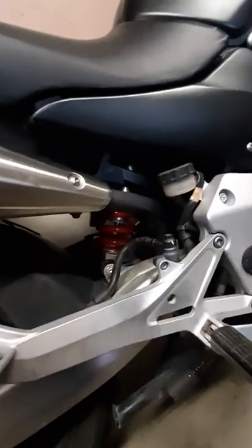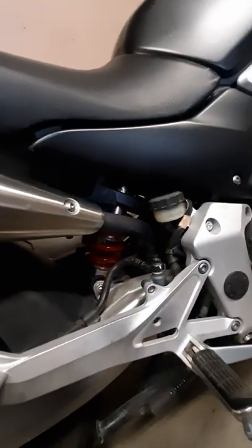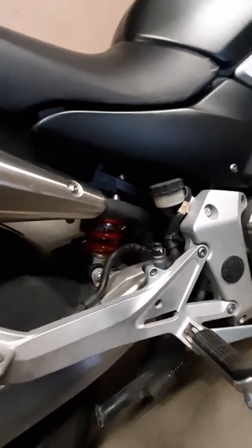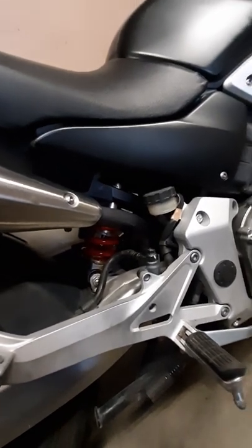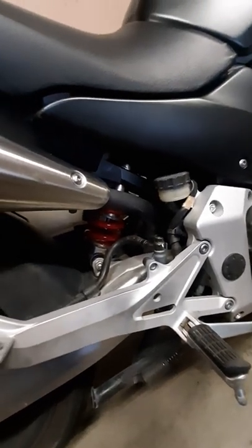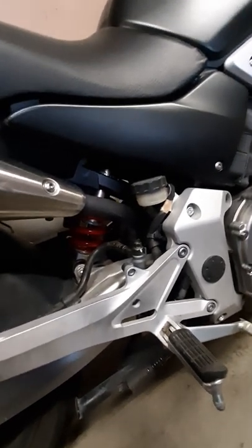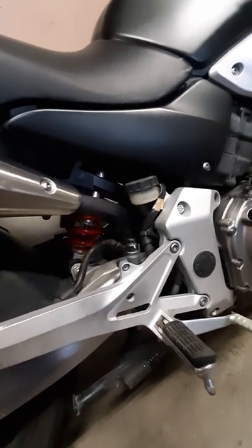This is the first time I've ever experienced it on a shock. I have the KX over here with similar rear suspension, a little more advanced, but I was experiencing cavitation in that rear shock. What that feels like is: you hit a small crack in the road and it would feel like something in the back of the bike was loose, or like the rear suspension was topping out - traveling upward without damping and hitting a hard stop. It sits pretty far down in the stroke when loaded.